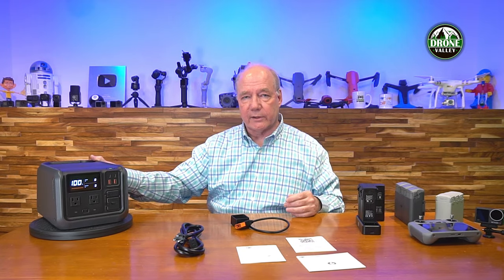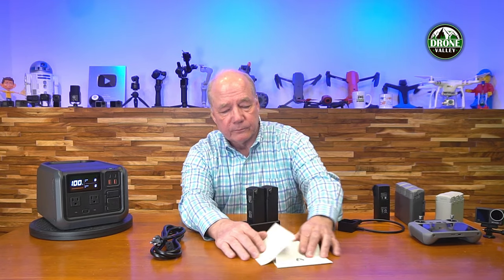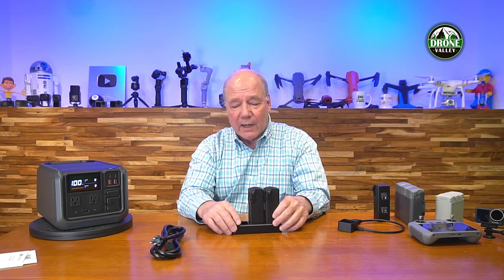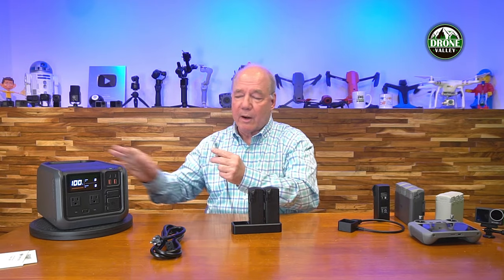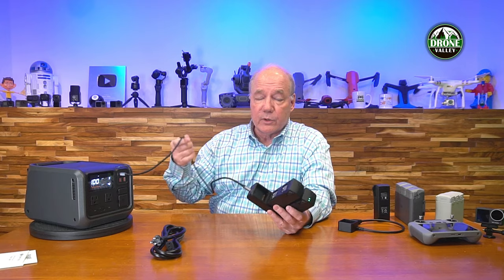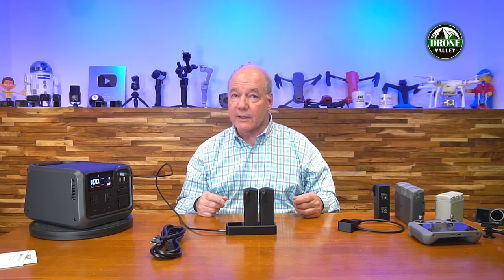Let me show you how this works. If you're out in the field without the adapter and want to charge your Mavic 3 batteries, you'll need a USB-C cable. Make sure you use a heavy-duty cable, because these ports charge at 65 or 100 watts — older USB-C or USB-A cables that can only handle 15 or 30 watts will choke the charging power. Use a newer heavy-duty cable that can handle 100 watts to be safe. When I plug in using the standard hub, the port negotiates and delivers about 65 watts of charging power — which will charge the batteries, but it takes a while.